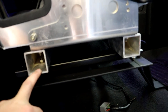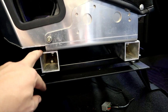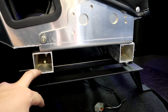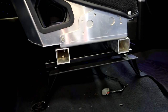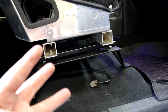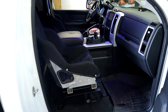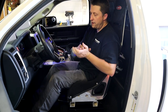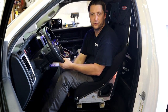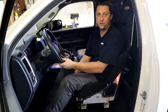Links to the seats and the Corbeau seat track brackets I purchased will be in the description below. The only thing not linked is the aluminum two-inch square tubing — I had some laying around already. You could use two-inch square steel tubing if you want, just note it will be heavier. You can probably find some at Home Depot or your local steel mart. Other than that, it's a very basic bolt-on deal. Both Kirkey seats are mounted on manual seat tracks — pull up and slide forward or backwards — so you can fit a short or tall person.